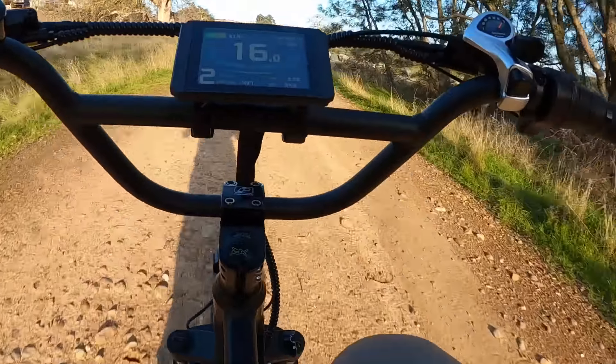Other than that, I'm really happy. I'm stoked that that noise is gone because it was really starting to bother me. It may not bother other people — you might really want the fenders. If so, find some rubber washers and put those in between. You have to take your wheel off like I showed you and put those in between the fender and the rear fork, and between the fender and this bar on the rack. That will reduce a lot of that noise — make sure they're really tight and you shouldn't have any other issues.